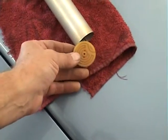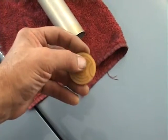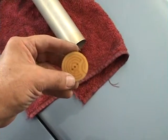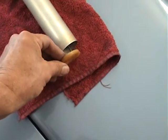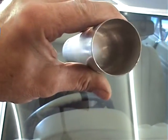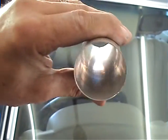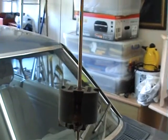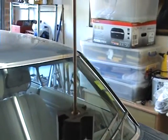This is the end piece that goes on the bottom of the tube. Just make sure all the slots and holes are clean — I just cleaned this one out. And that's the bottom piece. This is the tube the petrol goes in. Make sure that tube is clean on the inside. I got a rag and cleaned this one out. You can see there's a few fine wires around it — resistance wires — and it has a little resistor at the top.